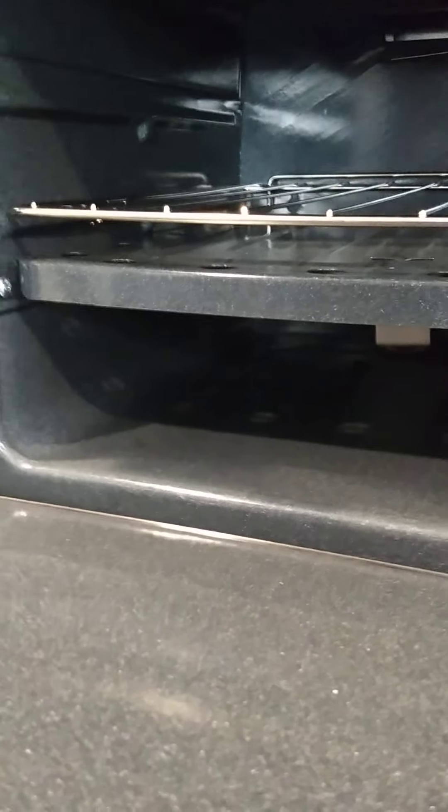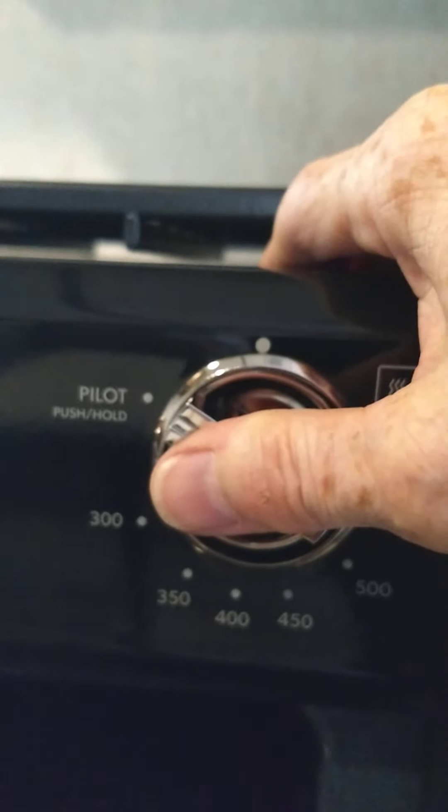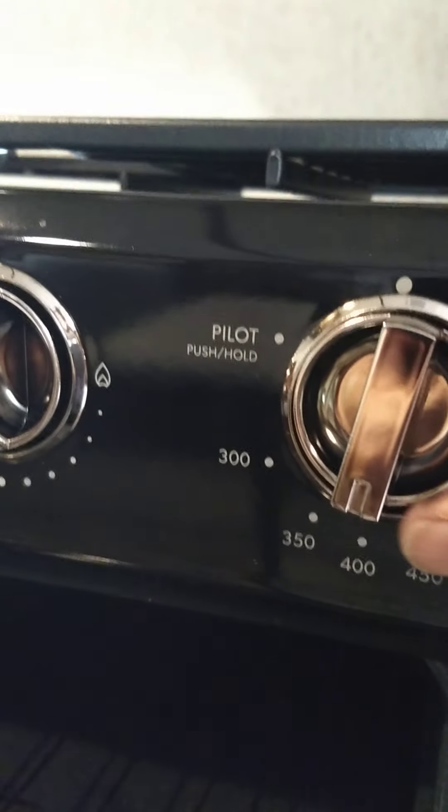The oven is a little different — it does not spark, so you have to use a grill lighter with a long neck to reach inside. At the very back is the pilot light. You go to the oven knob, push it to pilot, then depress and hold it in. With the other hand, spark it and light the pilot light back there. When it lights, hold it for another 10 to 15 seconds to get it to operating temperature, then go to whatever temperature you want. When you go back to off, the pilot light goes out, so you have to re-light the pilot light each time you use the oven.